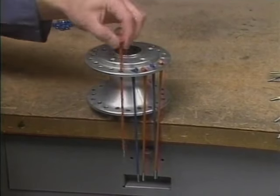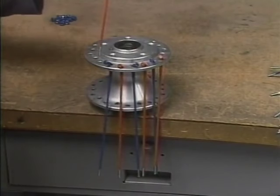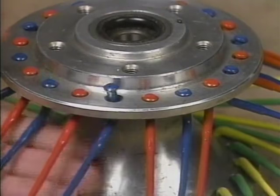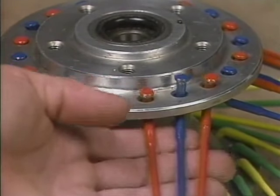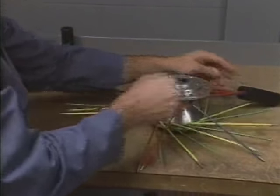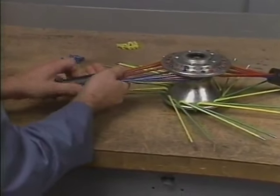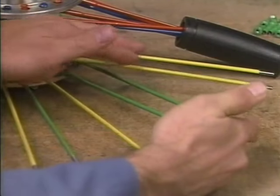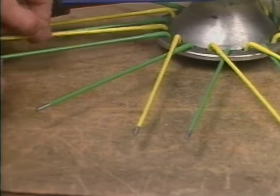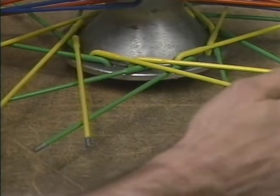Put all of the spokes in on both flanges. Then complete the following steps to lace a 19 or 21 inch aluminum hub wheel. No matter which of the two hubs you are lacing, double check your work by pushing up on the spokes and verifying the long and short pattern. Now bind up the top flange spokes into two groups of 10. Handlebar grips work well. On the bottom flange, point all outer short head spokes in a clockwise direction and all inner long head spokes in a counterclockwise direction. Turn each spoke as far as it will go in the correct direction.